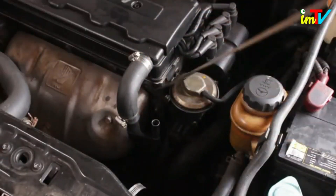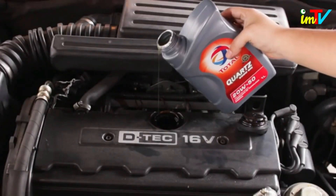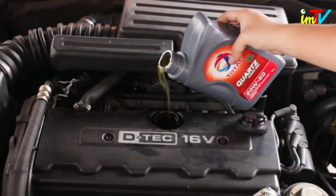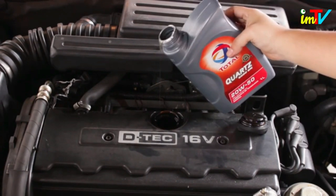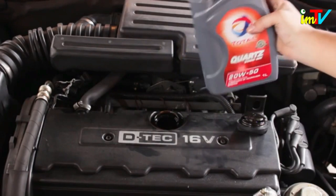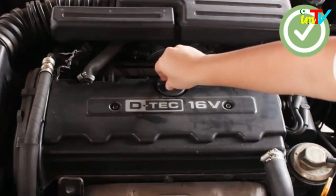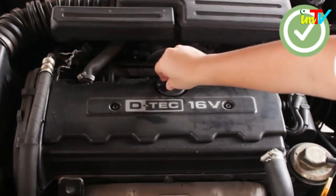Unscrew the top and set it aside. Check the dipstick to determine how much oil you need to add. Add oil slowly to the reservoir, checking periodically — add oil for 2-3 seconds, wait a minute, then check the dipstick. Clean it off when done. Add a little more oil and check again. You want the oil level to be close to the top mark on the dipstick, so get it as close as you can without overflowing. Close up the oil fill cap. You should rarely need to add more than a quart of oil — if you do, there may be more serious issues at play in the engine, and you should check the oil again within a week to check if it's leaking.